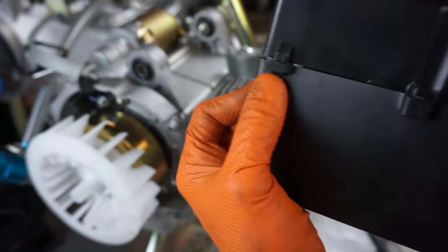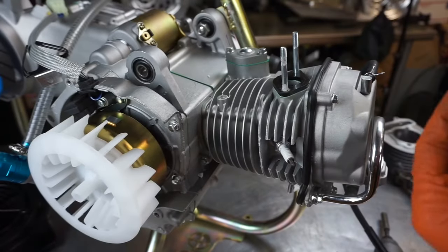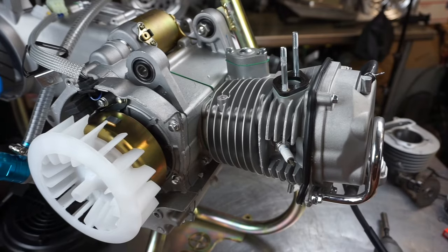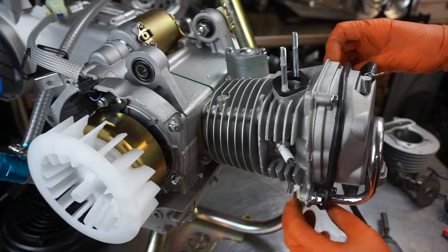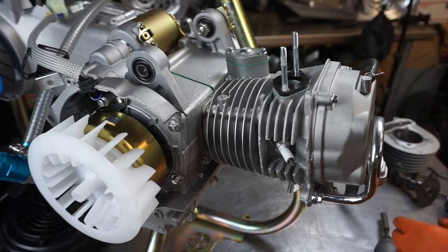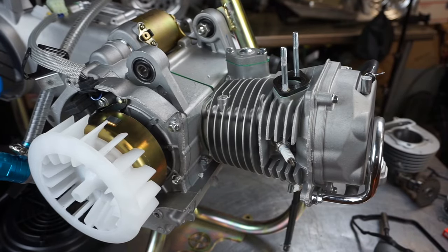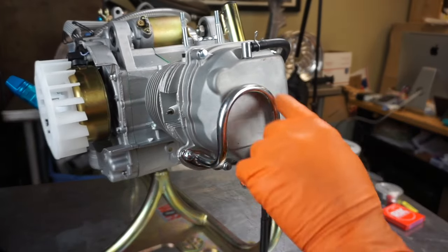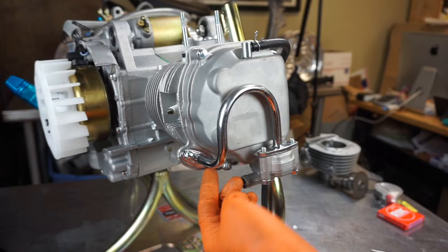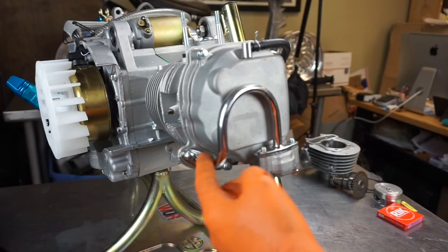See how these just plug in like that? So you don't want to tilt it too much. Get the shrouds out of the way, then remove this rubber gasket — you'll reuse that. A lot of times you'll find them ripped; you can get a new one if that happens. Now there are some 8mm bolts here, and then you've got this emission control — you can block that off if you want.